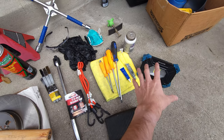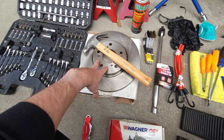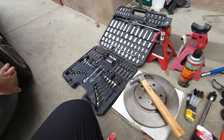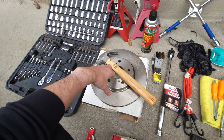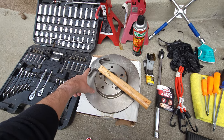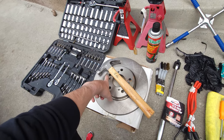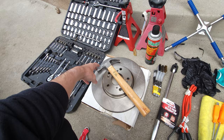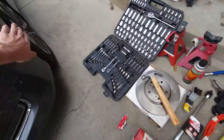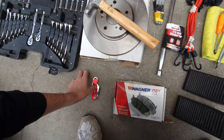I'm using a spotlight to help see everything easier. Next I have my Wagner brake pads, and then the rotors — I got these on Amazon, I'll link them below. On the Accord, the EX model has a smaller diameter, but this is I believe a 292 — don't quote me on that, I'll put it in the description. Next I have a hammer, preferably a rubber mallet so you can hit the rotor if it's stuck with rust. A regular hammer can warp it slightly, so I'm going to use the rubber piece from the jack so it doesn't directly impact the rotor.